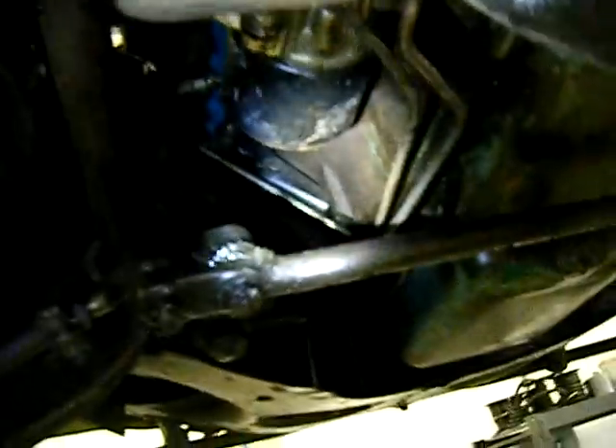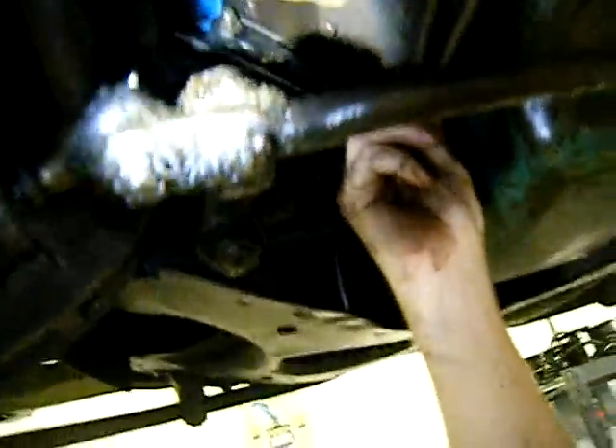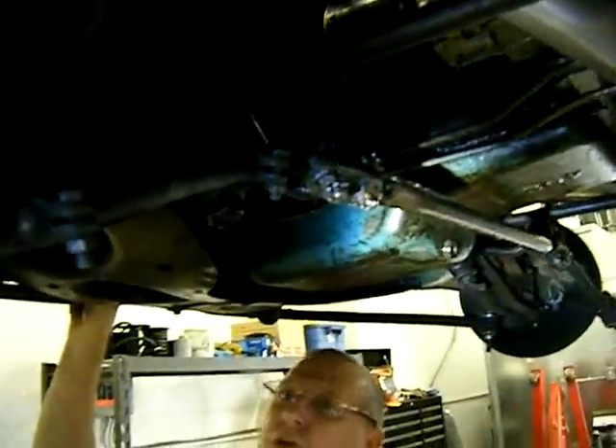It's got a little bit of motor oil leaking from the valve cover gaskets up there on both sides, so it does have a little bit of oil issues. The transmission lines are wiggling around here a little bit — they really need to be tied back better, maybe with a support bracket installed. It does have it going up into a transmission cooler, which is a good idea. I'd rather see a transmission cooler instead of going into the radiator — it's a much better idea to cool the transmission fluid.